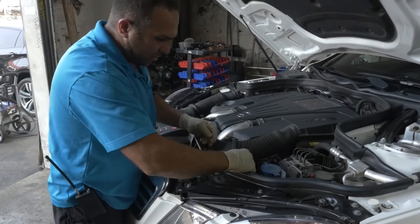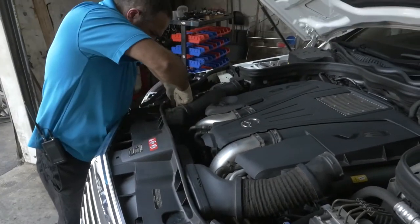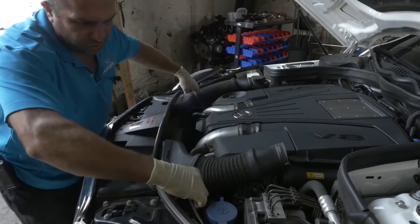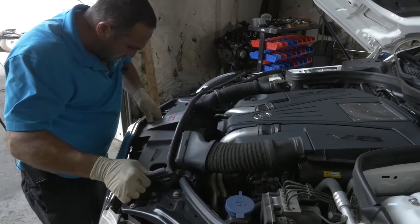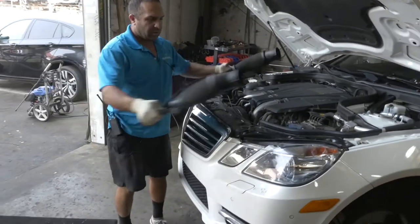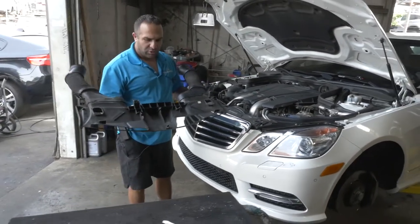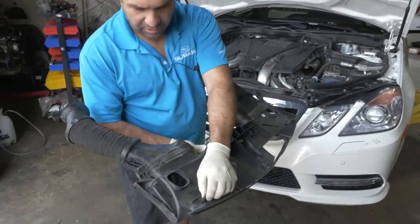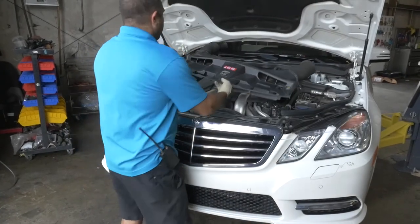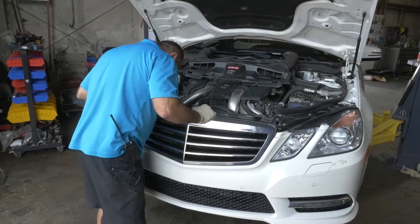There's a cable down in here — I'll show you guys this hood latch cable. That pops right over here and goes in there. These little things you've got to pull up on. There's no clips actually holding this; it's just little tabs here. I just kind of play with it — you can take it off from here or from there. It's easier to come off from there, so I took it off that way. Put that right here so it doesn't get lost. Make sure nothing goes into the engine intake — we're not getting that far into it, so I'm pretty calm about that.